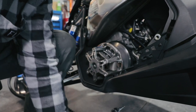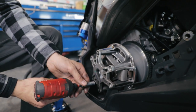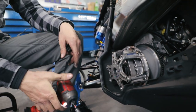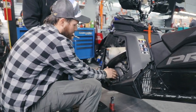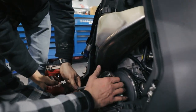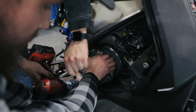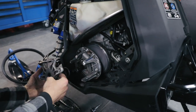After I got those four bolts out, I'm going to break these two loose just a hair. After you get these two broke loose, have a buddy give you a hand. I'm going to have Kobe run the gun. I'm going to put my hands like this and hold the tension on this spring while he pulls the bolts out the rest of the way. As soon as he gets all those bolts, let this out nice and easy — and then you're apart.